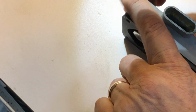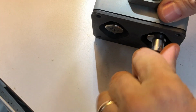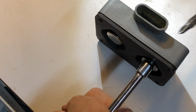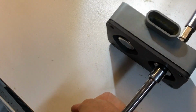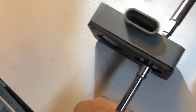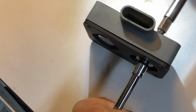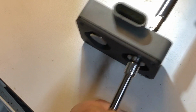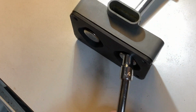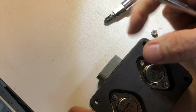And this is going to be a two-handed job in most cases. These nuts are Loctited in place, I should say. And I might not be able to do this on camera because it's an awkward setup, but you've got to break through that old Loctite. You want to be super gentle when doing this because you don't want to slip and hit the board. But at some point you'll feel that the Loctite has given way, and that you have the nut and the lock washer off.